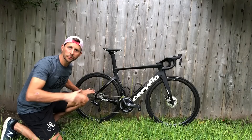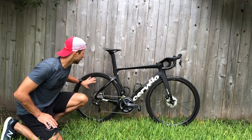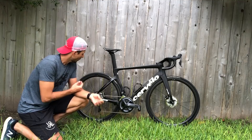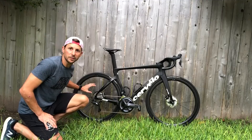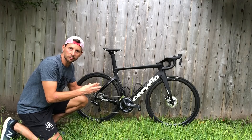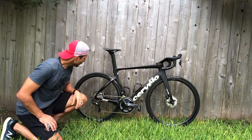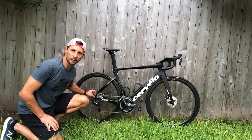The two main things to look out for on this bike are the through axle threads and the hub on the DT Swiss wheels. I had a flat on my first ride, and when I pulled the wheel off the whole freehub body came off. My shop said that the way these hubs work, the whole cassette is together — it didn't fall apart, but the whole cassette started coming off. So whenever you change the wheel, just make sure the cassette is seated on there well, because you can just pull the whole thing off.